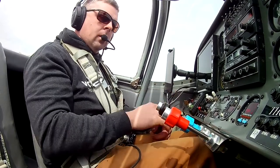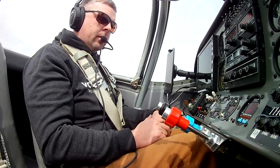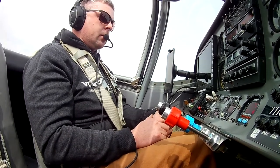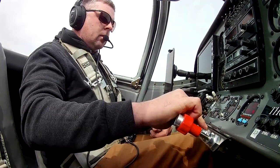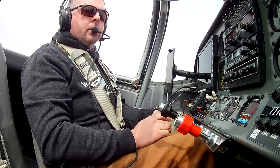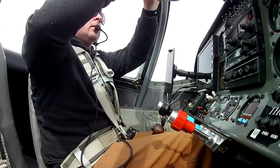Okay, now we're done with the run-up pad on the other end of the runway. Ready to do our run-up. We're well into the yellow now. We got great temperatures, so here we go. Do a little run-up quick. All right, prop. Make sure the boost pump is working. We got fuel pressure. All our gauges look good. Okay, run-up's complete.